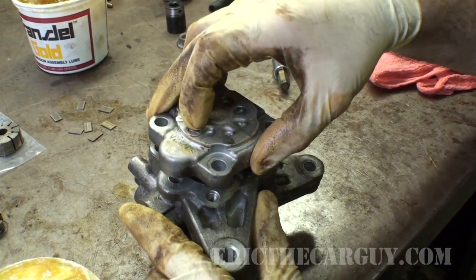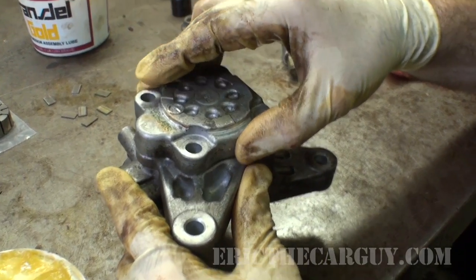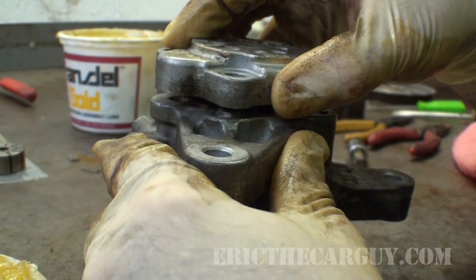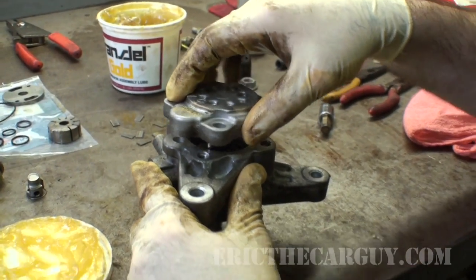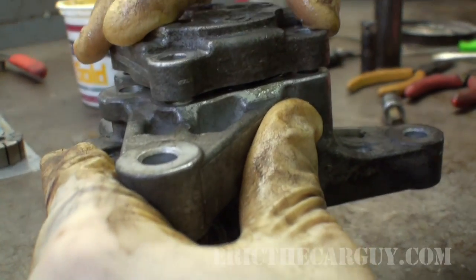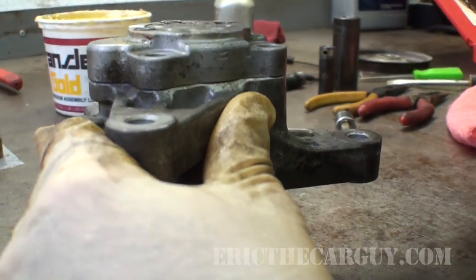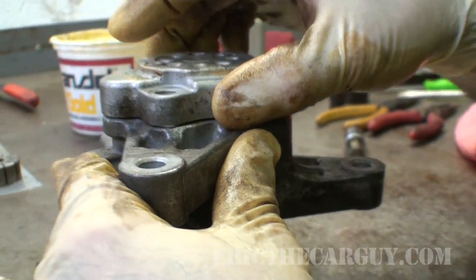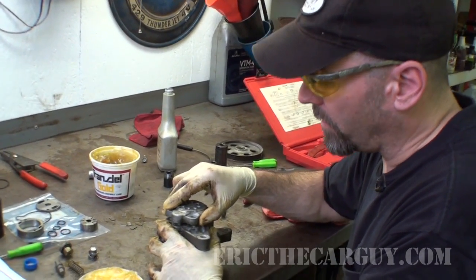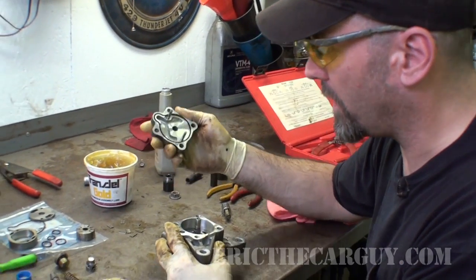The way I did that was I took everything out and just left those slots there just to see so that it would fit down on there flush. Because otherwise, it didn't quite want to go back together like I wanted it to. If you try to put it together this way, completely the opposite, it doesn't want to go together. But if you flip it around 180 degrees, it goes together fine. So it only goes together in one direction. So if you're having difficulty during reassembly, know that one of these is larger than the other, and it's designed so that it only goes back together one way.